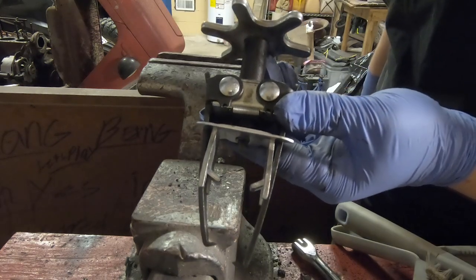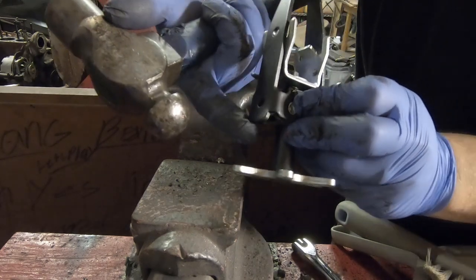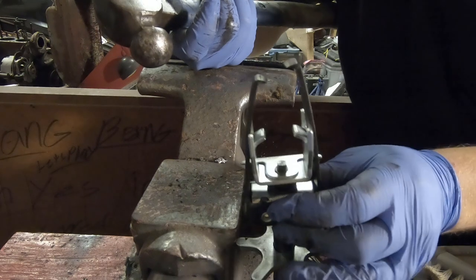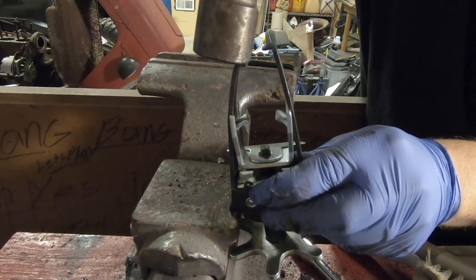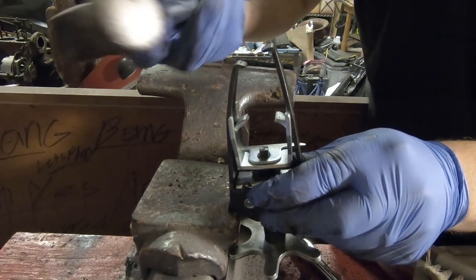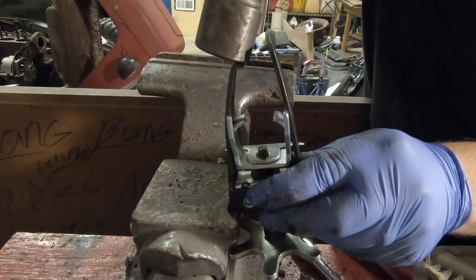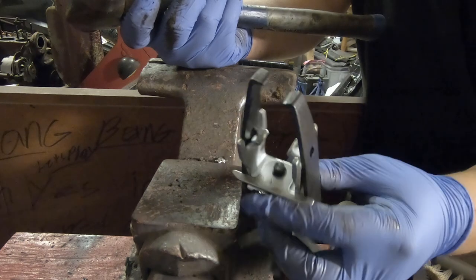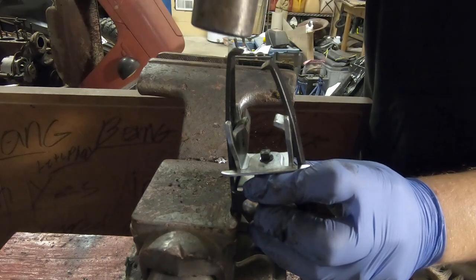To make it short and sweet, all I did was take this tool, flip it upside down, and rest this edge on the edge of my vise like that, then took a hammer and tapped it just like that until I got it rolled over just a little bit. You can actually see on this one it bent a little bit right here — that's okay, it doesn't really affect the performance. More or less just tap it until you get those bent over into more of a hook shape. Same thing, just flip it over to do the other side and rest that on the edge of your vise or something hard like a sturdy table.